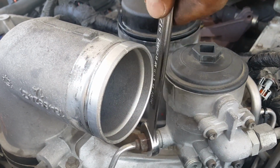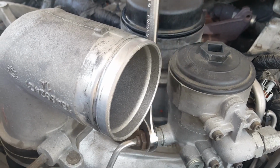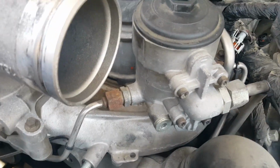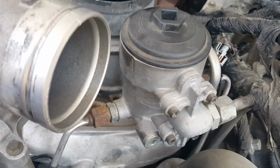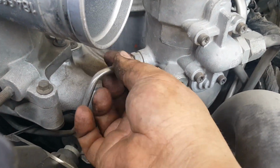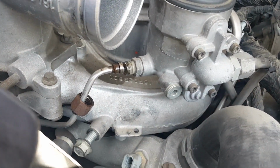To remove these fuel lines from the secondary filter that's located next to the oil filter, use an 11/16, kind of tap it to break it. Otherwise you're gonna need like a backup wrench so you don't screw it up. Like I said, there's signs of it being worked on already. It already has some zip ties to keep the bolt of the screw from actually sliding down and, you know, having to fish it. It just stays right there.